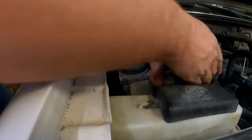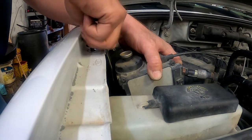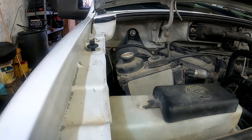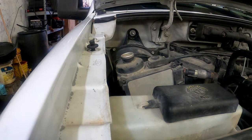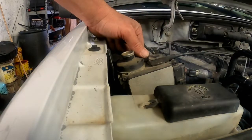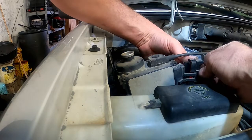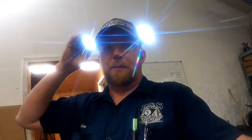We're just going to slide our cruise control box back in, 10 millimeter bolt right there — run it down, make sure the plug is plugged back in, and we're done. Just gonna pick the tools up. Guys, that's all it takes to change a blower motor resistor in one of these trucks. If you have any questions, drop them in the comments. Please don't forget to share the video, rate the video, and subscribe to the channel. We'll catch you on the next one — thanks for watching!